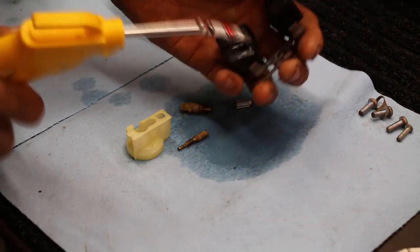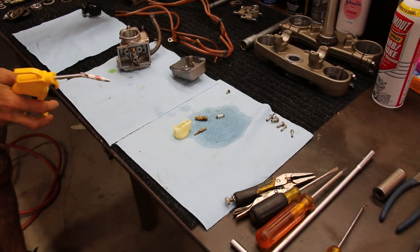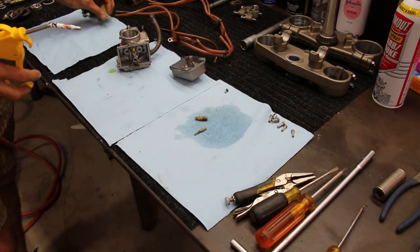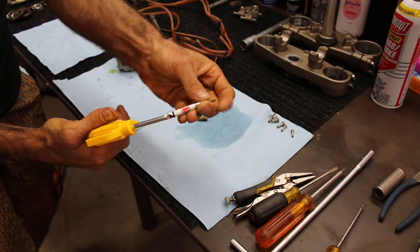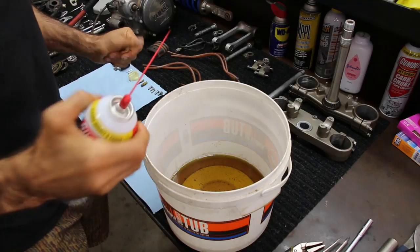Compressed air is going to be your final cleansing. If you don't have access to a compressor, I suggest you borrow your buddy's or figure out a way to get it. This is the step that really gives you confidence that you're getting all debris and excess cleaner out of these little holes. I even hold it up very close to the jet and make sure I can literally feel the air coming out the opposite side.